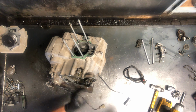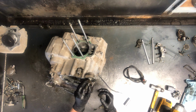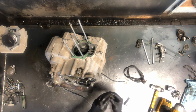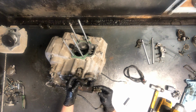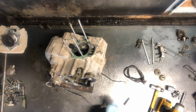And your idler gears here, 2 sets of them. This will go directly onto the starter here, and this obviously just spins when the starter is spinning. Spins this gear here, and then it goes back and spins this one. We're just gonna be able to pull the top one off of this, as this other one's behind the flywheel there. So that's part of the idler gear system.